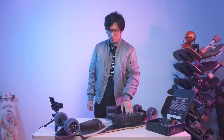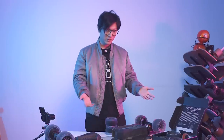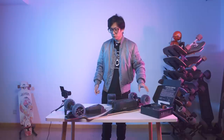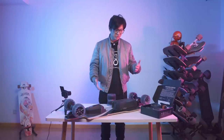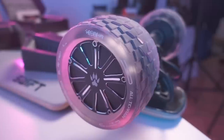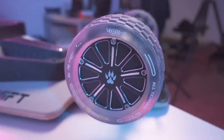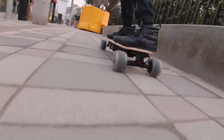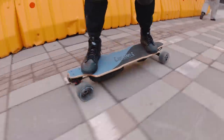How do I personally feel about them? Depends on what I want to do. For certain boards I feel they're a great fit — for example, the Lycaon Swift. I think these are fantastic on the Lycaon Swift, both aesthetically and because the Lycaon Swift's main selling point is range. If you put on really soft rubber wheels, you're gonna eat up a lot of that range. If you put on Cloudwheels instead, you'll still lose some range, but not nearly as much. And if you're using hub motors on the Lycaon Swift, you can get the Cloudwheel Donuts — they do the same thing. I've tried them on that board and they certainly feel better than the 90mm hub motor wheels.